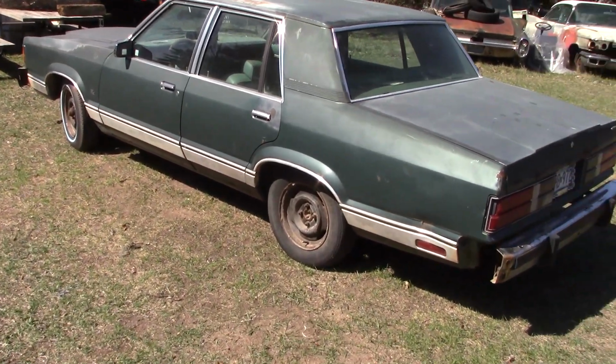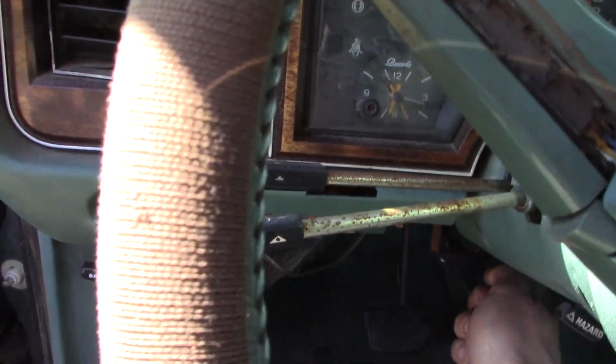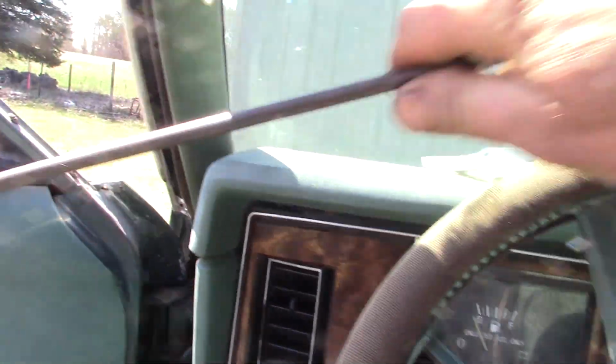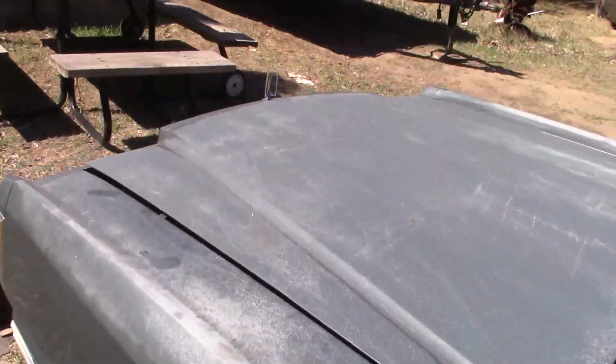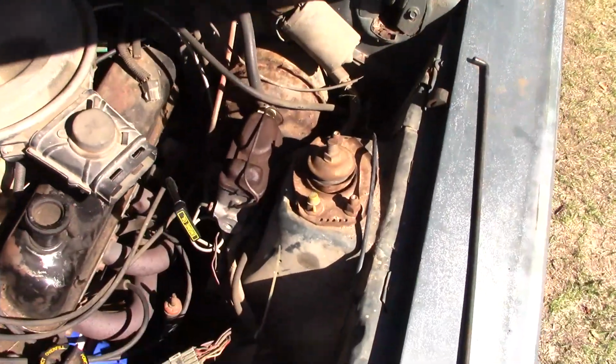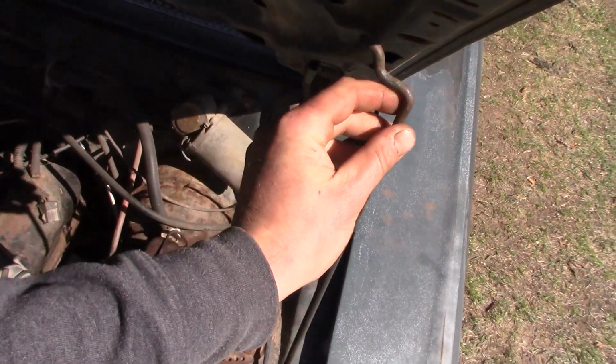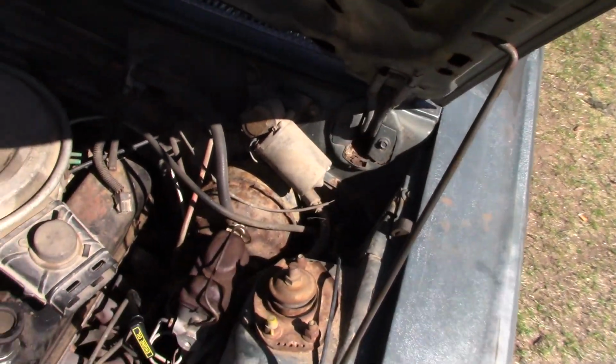Well, I suppose it's been probably a month and a half since I started the video on this car. I've been tinkering with it off and on when I've had a little bit of time, but the prognosis is not great, we'll put it that way. So I got that Holley to finally stop dumping fuel. I took the power valve out and changed it because the Chinese kit power valve didn't actually fit. It wouldn't even screw in, so I got another power valve, put that in, and it stopped dumping fuel, but it still wasn't running right.